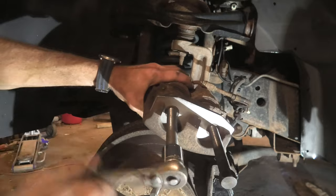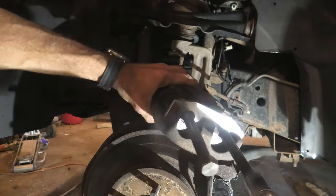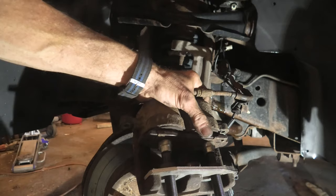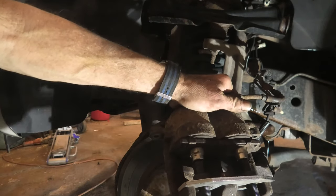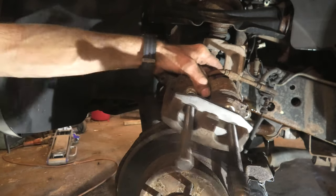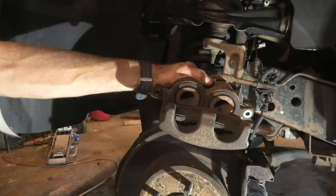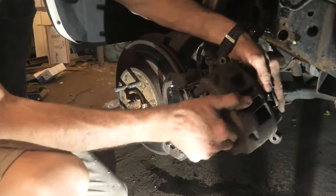I'll put a link in the description — I don't even remember where I bought this one anymore, but Harbor Freight likely has them. We're just about have it compressed in where it needs to be. As stated in the first part, they should press in easy — if not, there is a problem. There, press back in. Take our old brake pad out that we used to support it and just slide the caliper back on the bracket again.